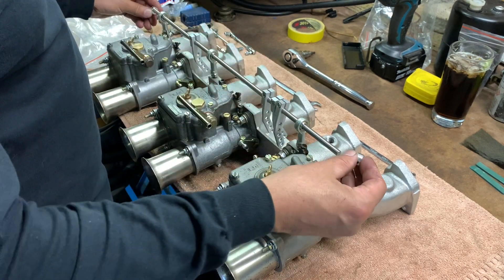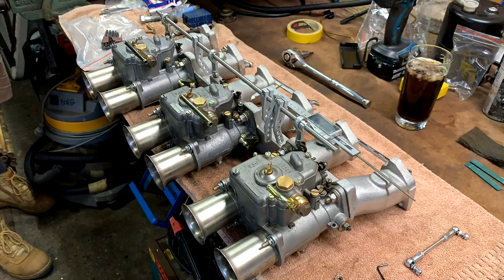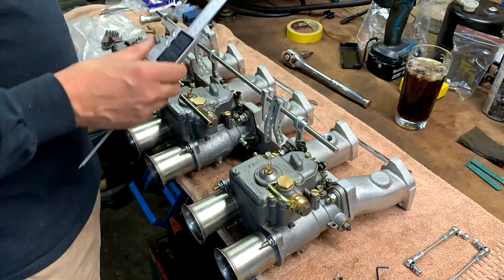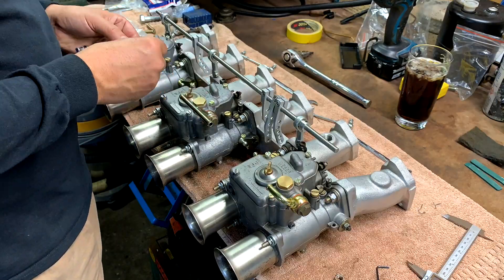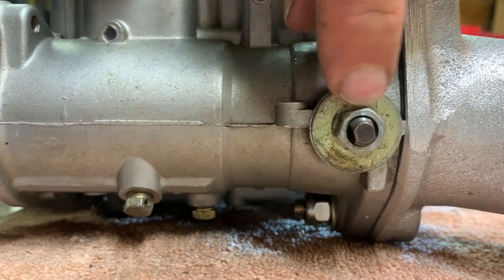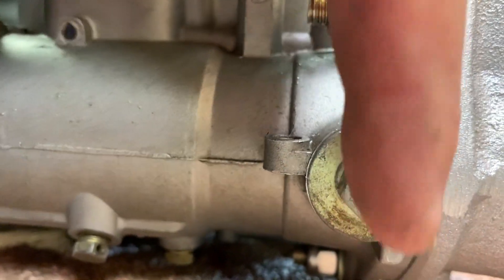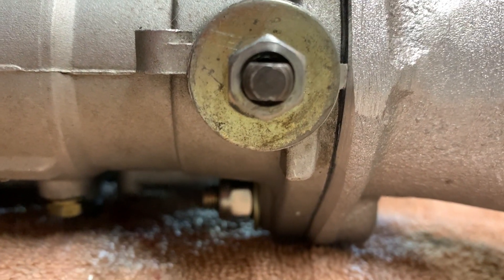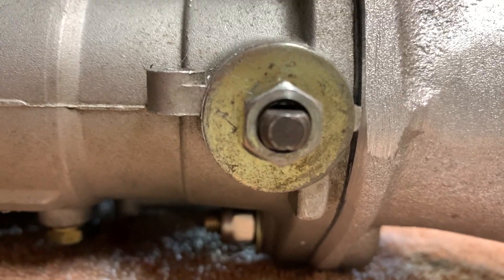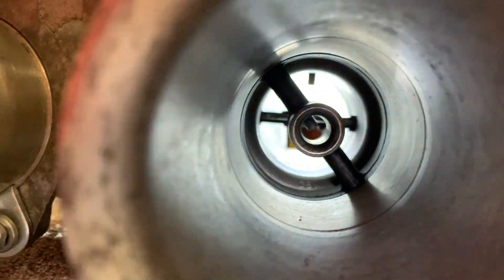Little stoppers. All right, so the two flat edges — that's pretty much where the throttle blades are. They should be pretty straight like that. That's full throttle — that's the one where you can check. Straight with the body, then they should be flat out. Look at the other one — same way.